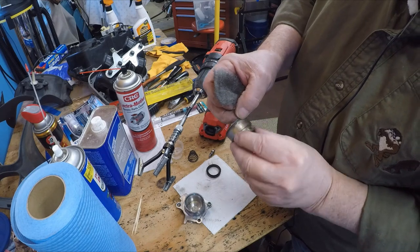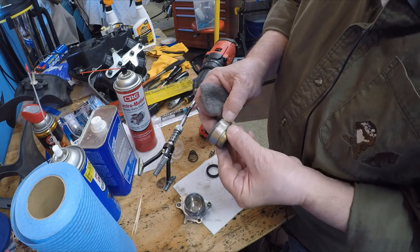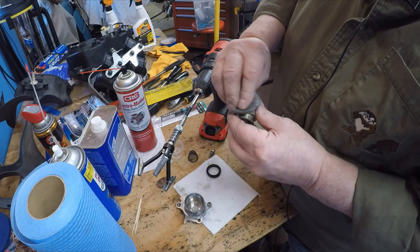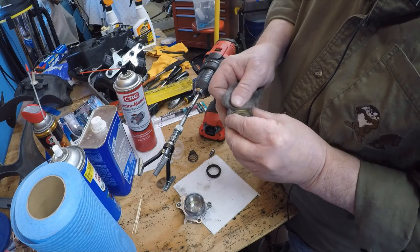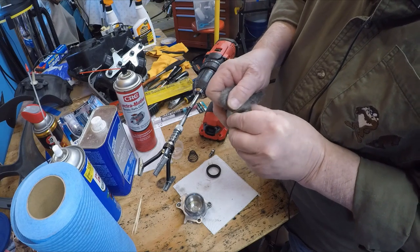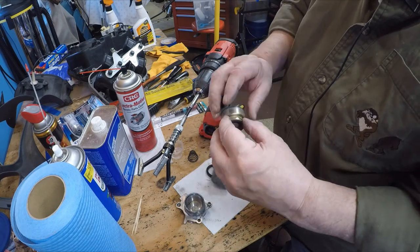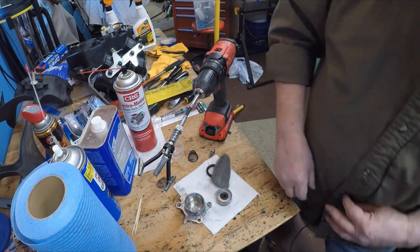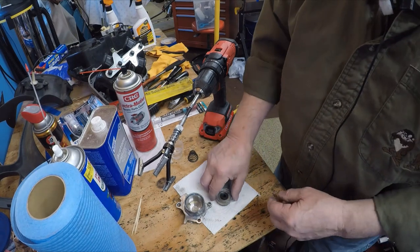On this plunger you can see the blackness - probably a little corrosion. It's a 1993 bike and that may have never been done. I'm going to put it in a lathe and turn it, holding the steel wool on there. I forgot I had the compressor on.